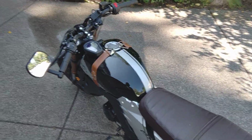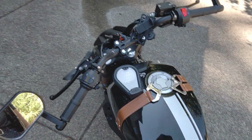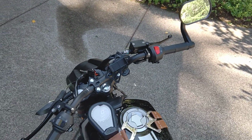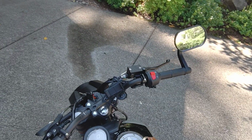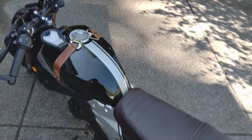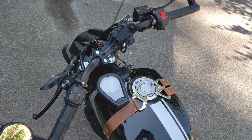And then, you know, the big thing people are worried about is the reliability. This is damn reliable. You can see here on the revs, we rev up to about 9,500 RPM. I've taken it past redline a couple times. My big fear with that is, I know Small Engine Velocity Caesar over on his channel, he had a KPR that he took past redline on accident. I think it was an accidental downshift or something. It did mess up the valve clearance. So doing that, you do have to be careful. But, you know, in my experience, it's been hard to do that. There is no hard rev limiter, so keep that in mind.